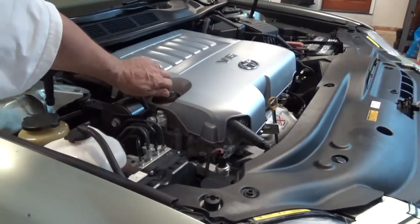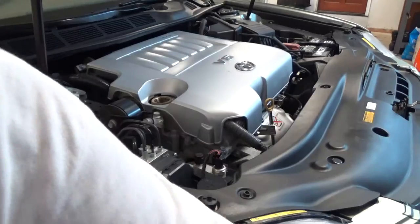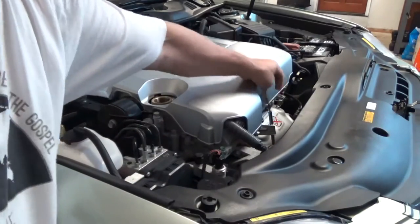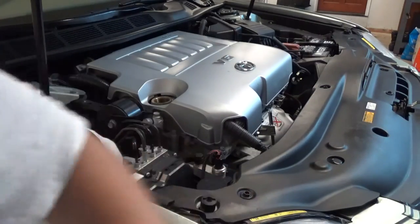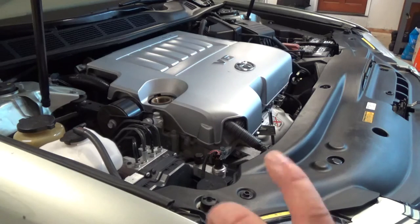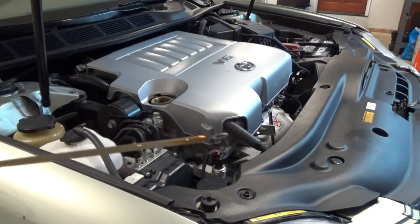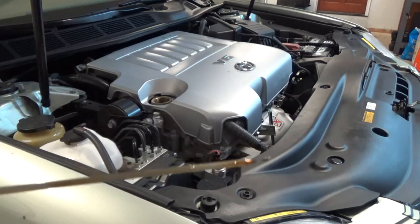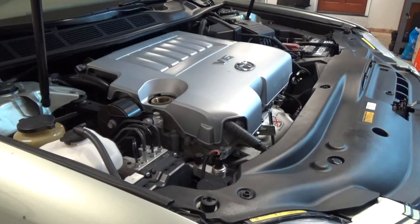Even before I drain it — which it's already drained and put back together — I typically take the oil filler cap off and the dipstick out. Then I fill it up with about six and a half quarts, but typically I put six in there first and then read the dipstick. However, on really new cars — 2020s and later — most don't even have a dipstick; BMW and Volvo got rid of theirs years ago, so you just go by the electronic reading.